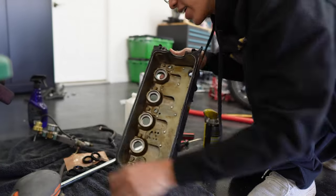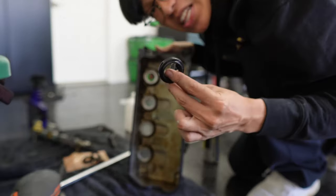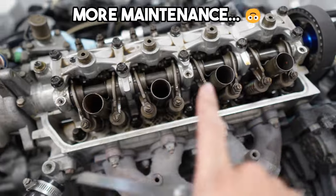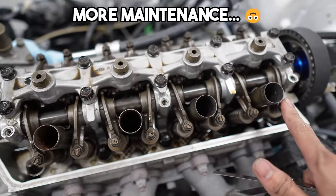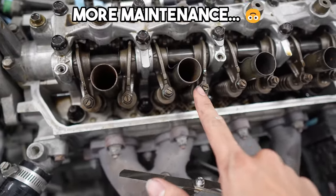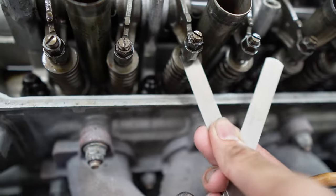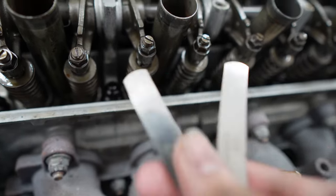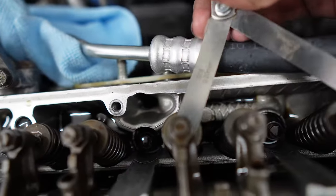All the rings are out, now it's time to put in these new ones. I'm finishing up the valve adjustment — already did cylinder one and cylinder three. On the exhaust side I'm measuring at 0.25 millimeters. On the intake side it's 0.2 millimeters, and as you can see it's clearing just fine. Over time they get super tight, so I'm sure this helps performance and MPG.